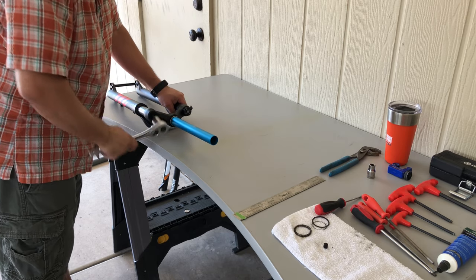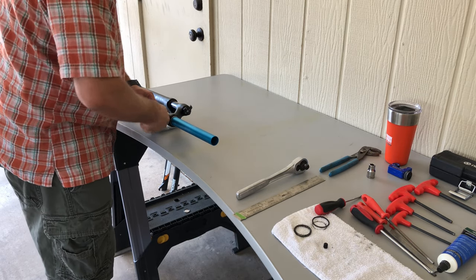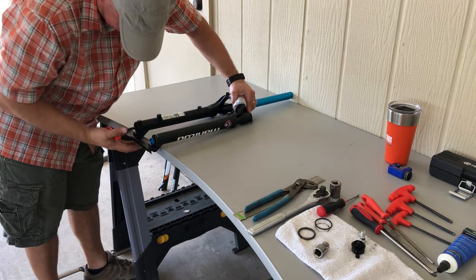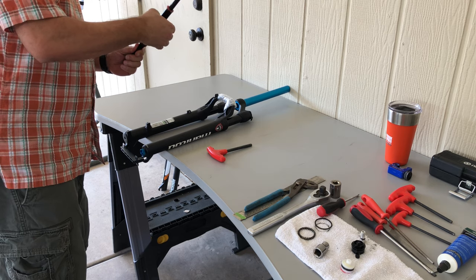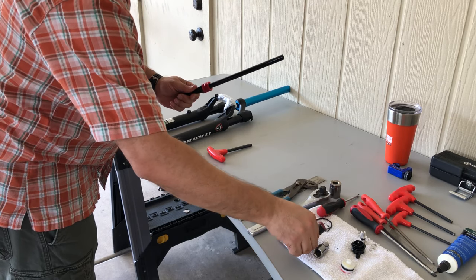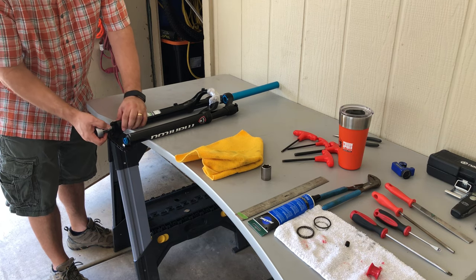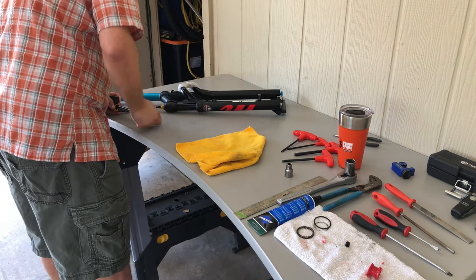First, we'll convert this fork to 120mm of travel by removing the 20mm spacer. Deflate the shock, then take a 13/16 socket to remove the cover with the Schrader valve. Next, use a 7/16 socket to remove the oil plug. Be sure to keep the fork flat to prevent losing any oil. I used an 8mm hex wrench to push out the spacers from the top of the fork. Remove the rubber gasket to access the spacer. Add grease if necessary and reinstall the rod. This next part was tricky — you need to slightly turn the star-shaped rod so it slides back in properly. When aligned, it should go back in quite a few inches. Once back in place, it should line up with the oil plug bolt and you can tighten it back on. Install the cap, then add air back into the fork.